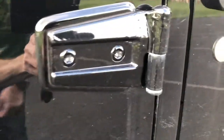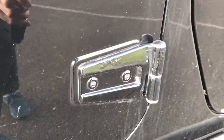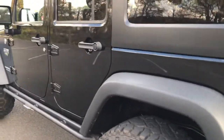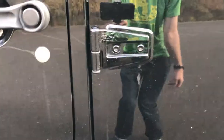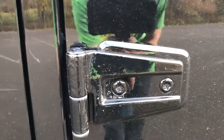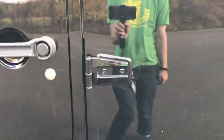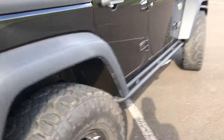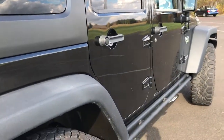To illustrate the issues with the hinges — I did put it into the video — the problem, as it was explained to me, is that Mopar used aluminum hinges. So that's not rust, that's oxidation forming underneath the paint, and eventually it is going to start to chip.